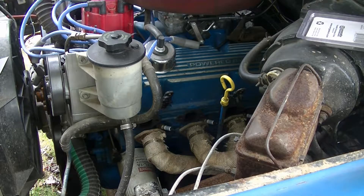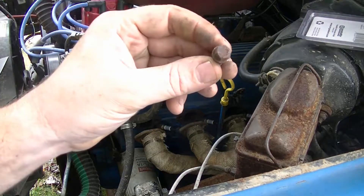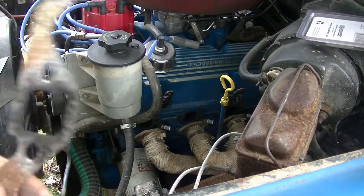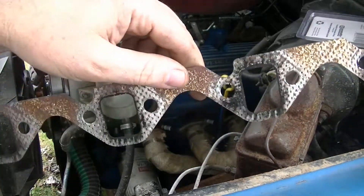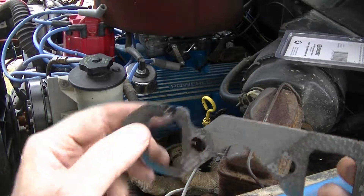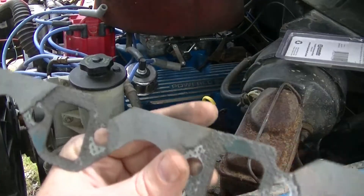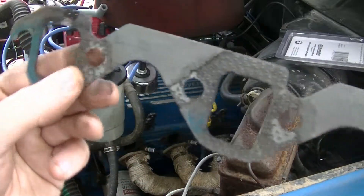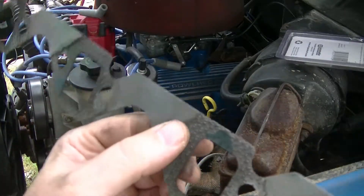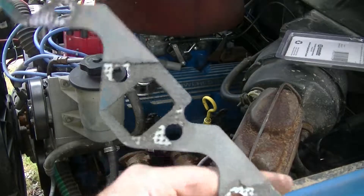What I've done is I've gone ahead and pulled all the bolts out. Getting them out is a lot easier than putting them back in. I got them all out and pulled my gasket out, or most of my gasket. Right here is where it was leaking — you can see the black soot coming out. But when you take it off, all around them, every exhaust port, part of the gasket stayed behind. So I'm just going to scrape it off.